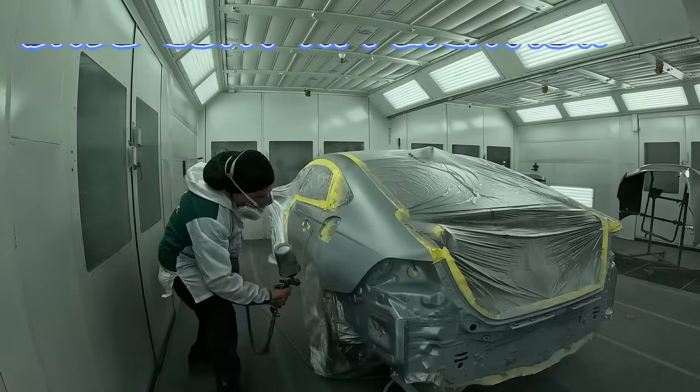All right, guys, I gotta tell you, man, the more and more that I spray with this stuff, the more and more I'm falling in love with this stuff. This stuff is almost unbelievable, the way it covers, how the metallics lay out. You guys see, we went in there, we put one coat on. The biggest thing that I had to do is understand that I'm putting one coat and then I'm done with the base coat application. That's the hardest part of it all. Being thorough, getting around your edges, laying it out nice and smooth because you're only going in there one time for your base. That's been the biggest issue for me to be reset to putting it on at one coat. But I'll tell you what, this base coat is unbelievable and this clear is just phenomenal.